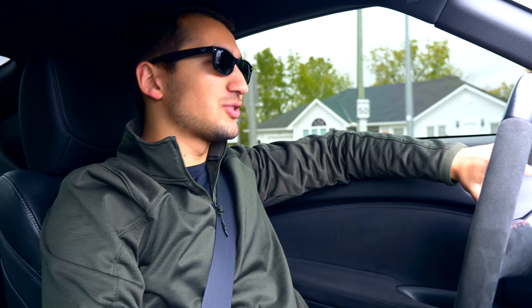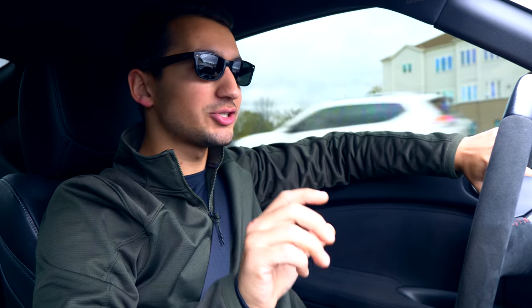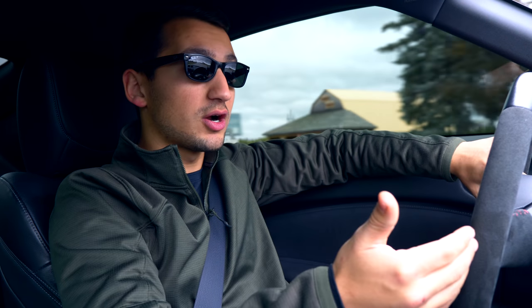What do I think of this new clutch pedal? My first impressions — holy crap, I don't know why I didn't get this a long time ago. When you have the replacement clutch pedal installed, you will feel the exact point where the clutch engages with the transmission — you didn't get that feel beforehand. It's super smooth and feels like a normal clutch pedal. You get a really nice linear feel, a nice engagement point — it's very predictable and not numb like the old setup. The old setup would snap past the spring position and help push the clutch into place, making it very difficult to modulate — very numb, hard to get a good feel, difficult when starting the car or slowing down.